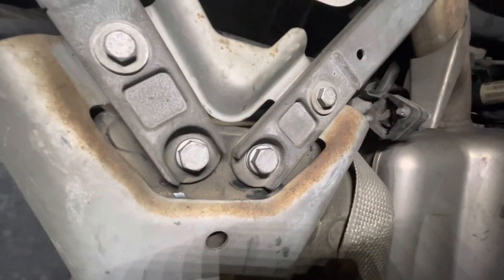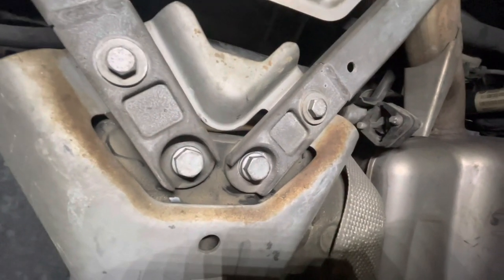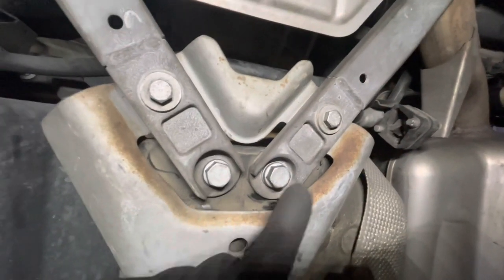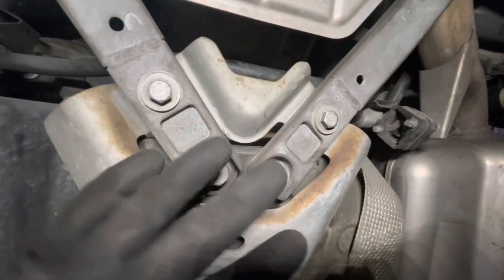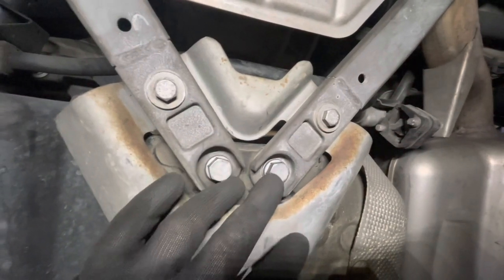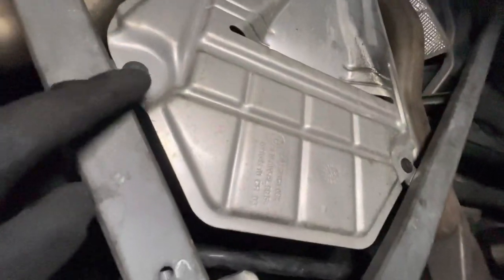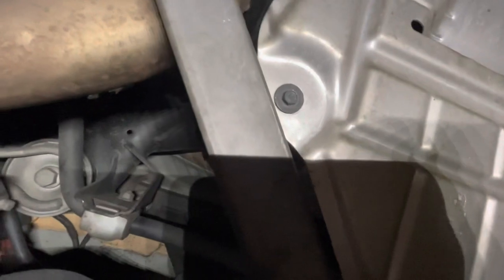Back under the car, and on the home stretch, this brace piece goes back in now. These bolts here, the 16mm head, I think they're M10, 50 foot-pounds or 67 newton-metres. Both ends of these braces and the other ends back up there. These little screws back in, and the 13mm ones, wherever they are, back up here, hidden up in the hole there. The 13mm nuts in there, just did them up by feel. And that concludes everything under the car.